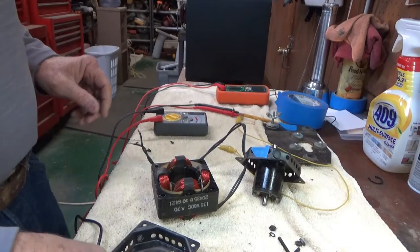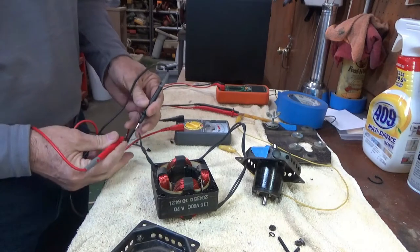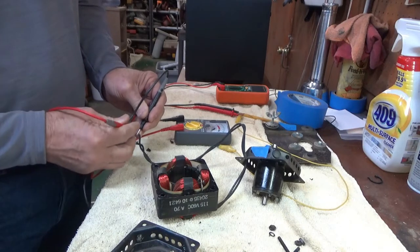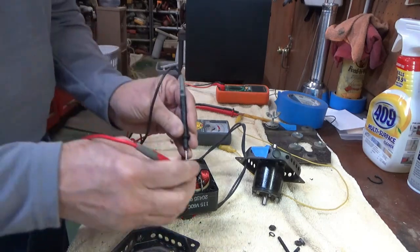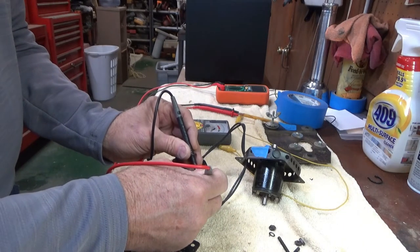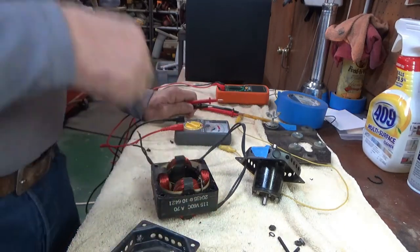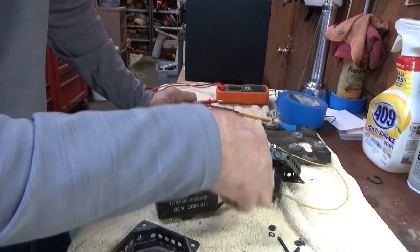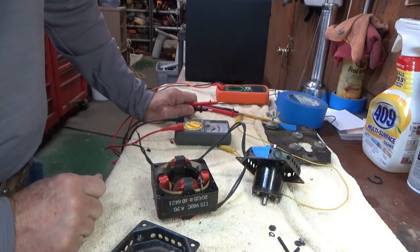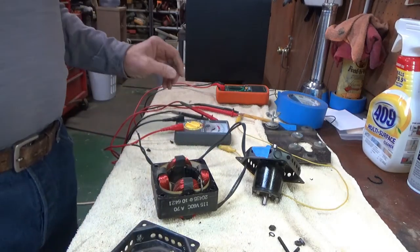There's a good sign anyway. Using a little cheapo meter here — sometimes it's easier to look at the analog for gross measurements. I'm still seeing no continuity through the wires, but if I go right to where the wires end, I'm seeing about 15 to 20 ohms, which is what I saw on that skill saw. So it looks like the coils have continuity — it's just the wiring. Either it's broken somewhere or there's a bad solder joint. I'll try re-soldering those first, and if that doesn't do it, I'll just replace the wire.